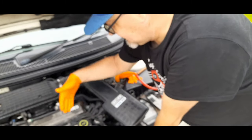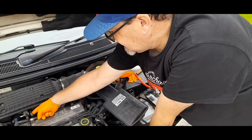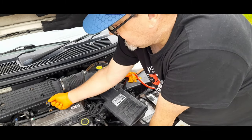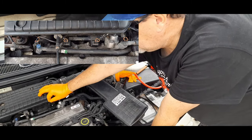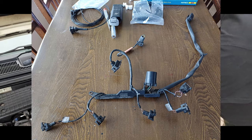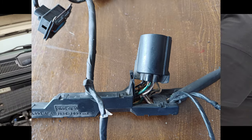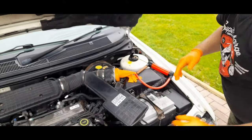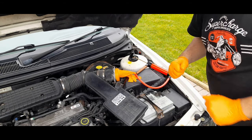The last thing we've got to look at then is the HT leads and possibly the coilpack. I've done these off camera but these are all new pigtail clips which go to the injectors — the old ones were all bare. I did that off camera because it was quite fiddly and I needed to take the whole loom out. But they're done, they're all new and I know they're working fine, so that's not the problem. Without further ado I shall go and grab an assistant and we'll start pumping some smoke.